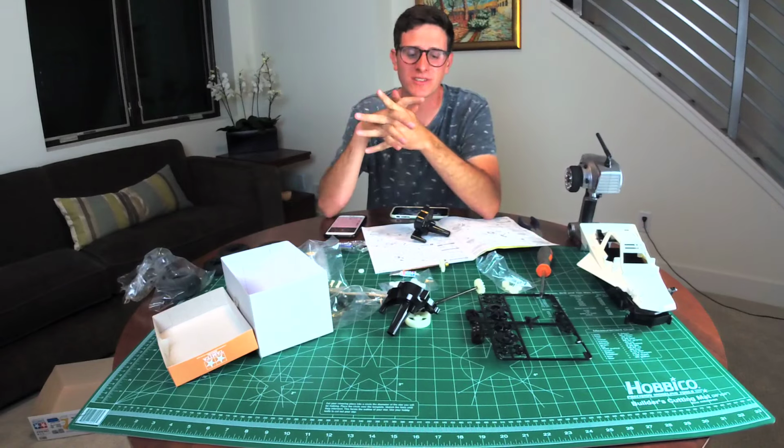Okay, we should probably talk about that. Well, we can go down the Touareg rabbit hole real quickly. Touaregs are separated into 3 generations: T1, T2, and T3. We have a 2004, which would have been a T1. It's the old roundy one. And there were 3 engines here in the U.S.: a 3.2-liter V6, about 240 horsepower, a 4.2-liter V8, 310 horsepower, and then a 5-liter twin turbocharged V10 diesel with 550 pound-feet of torque, an absolute monster.